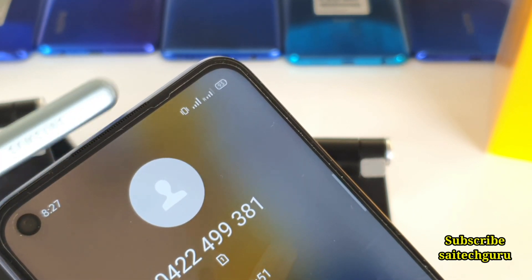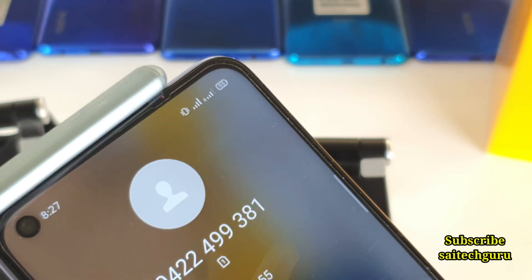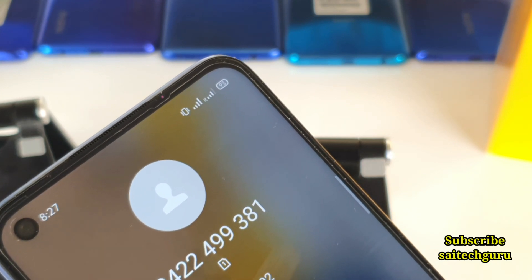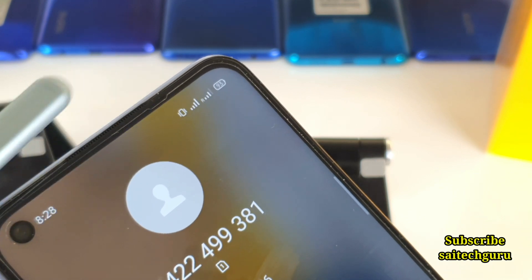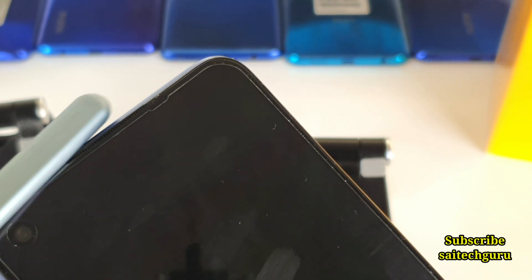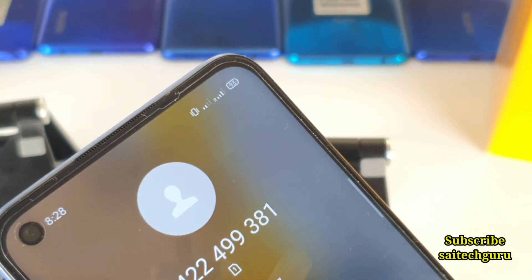As you can see, the light is blinking. The proximity sensor is located on the top bar — it's not in the screen, which is a good advantage. However, you need to be careful about using a good tempered glass. If your screen protector is blocking the proximity sensor it will not work at all, so you need to have a small cutout near the proximity sensor.